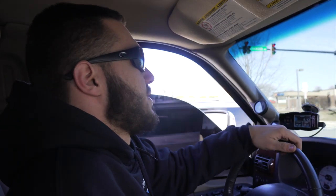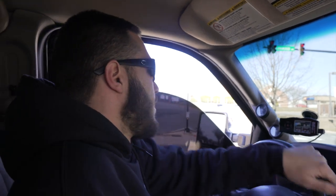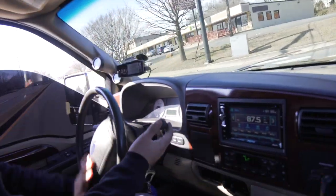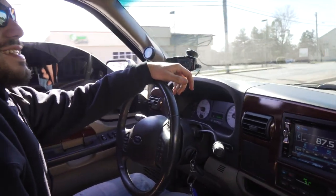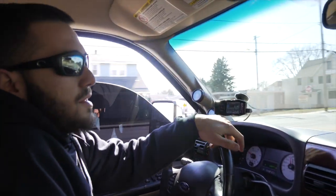My boy JC does most of my work — he works for Ford so he's got the knowledge and know-how, and owns one himself. We sit there countless hours trying to figure things out. There were a few little hiccups I had to address. The FICM decided it wanted to take a crap — it was running at 23 volts. I don't even know how the truck was still running — it normally operates around 48 volts. Then doing the two-star... it scrapes a little bit on the side. I'll get it fixed.